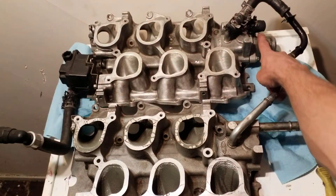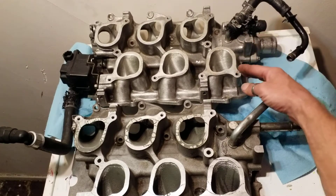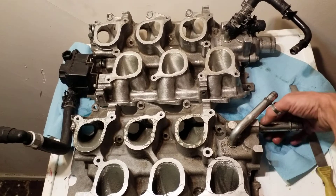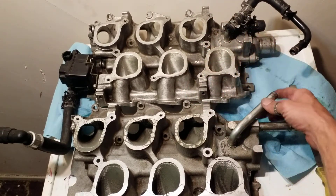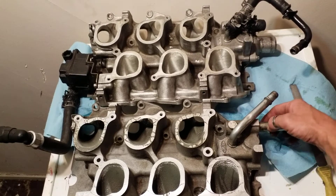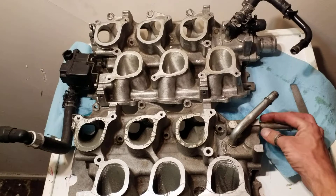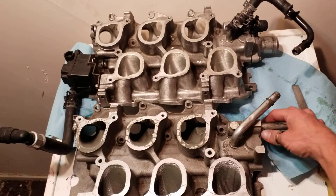What you're going to end up having to do is plug it off in whatever way necessary. You can pull it down and tap it. This is my original intake construction, so I did this all on the vehicle — you can build this as it sits in the car. I used a pipe cutter. You can go to Home Depot and find the little cutter that you cinch around this and tighten it, and as you tighten it and spin it, it will cut this off without making metal shards everywhere. What I did was leave a bit exposed to put a cap on it, and then I put a socket covered in JB Weld on the inside to make a full plug so that the pressure is relieved at that joint, otherwise your plug is going to blow off. It's basically making a cork and a plug. Tapping and capping it off would probably be the ideal way to do it.